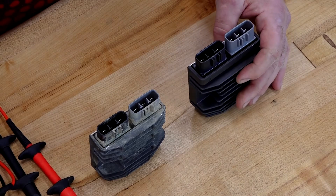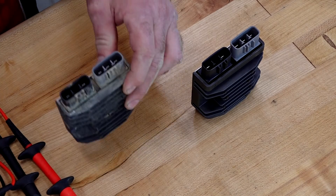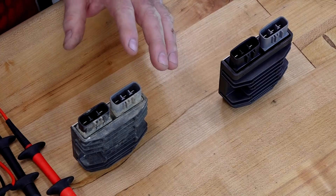So what have we learned? It turns out you cannot do the same diode test on every single manufacturer and expect the same results, because the internal circuitry is going to be different from one manufacturer to another. We were able to compare it to a new one to determine this unit was okay. But are you going to buy another one just to do your testing? Probably not. So here's my advice: check your battery first, then check the output of your stator — that's a dynamic test, and we have a video that shows you how to do that. By process of elimination, it's probably going to be your regulator rectifier.